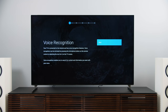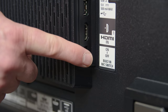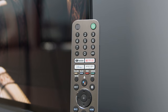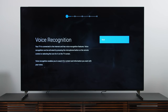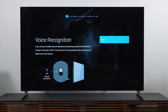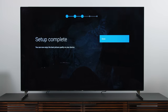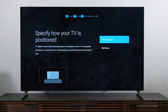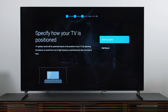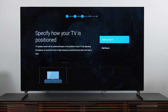There is a microphone built into the TV at the very bottom. If you do not want this TV always listening, go to the mic kill switch on the back and turn that off. There's also a microphone in the remote control that only functions when you ask it to — so you don't have to use the TV mic, but it's there for basic adjustments and navigation. Then it goes through device detection. I only have one device connected — a Sony 4K Blu-ray player — and it accurately detected that device so I can control it with the Sony remote. Next, it wants to know whether you stand mounted or wall mounted the TV, because that affects the acoustics and the TV will make adjustments, primarily in the bass region.